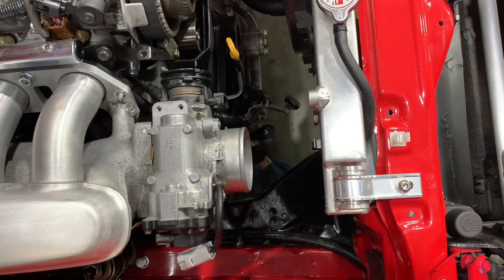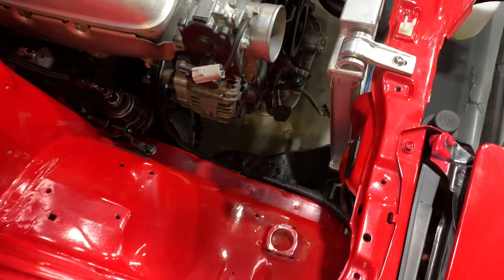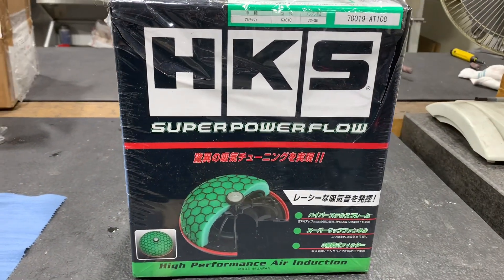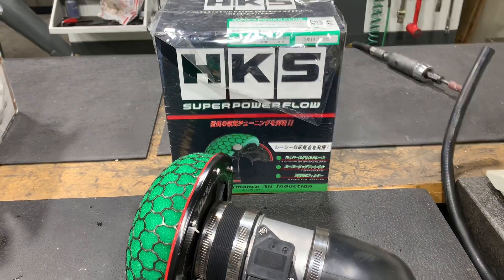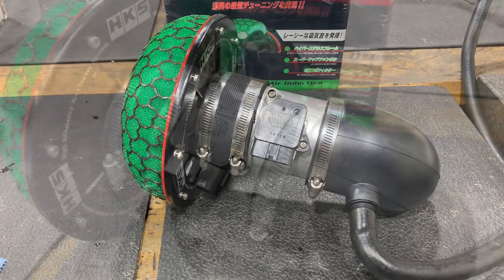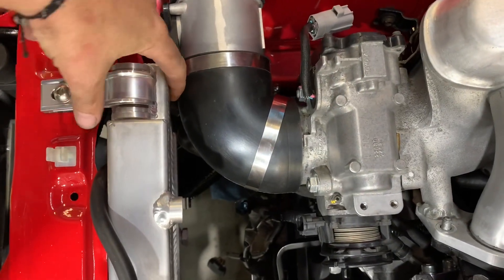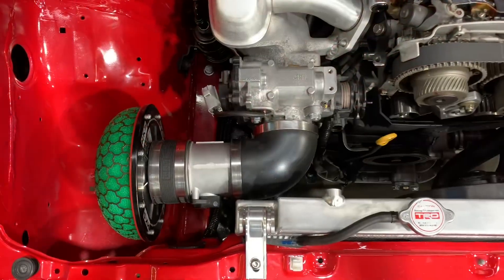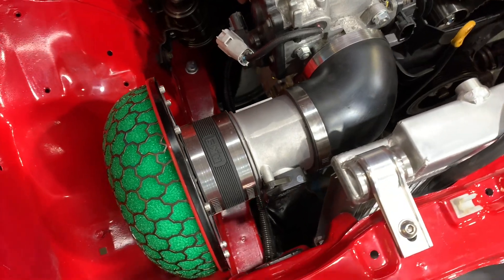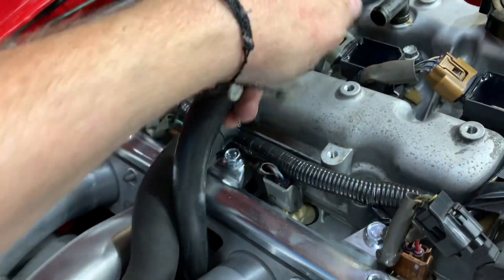The intake setup for the swap is a pretty tight fit between the throttle body and the radiator. We found that the best option was the HKS Altezza intake system, which fits into the open area pretty well. The kit comes with everything you need: the air filter, a rubber coupler, an airflow meter housing, a 90-degree coupler to the throttle body, and all hose clamps and new screws for the airflow meter. The only modification I made was cutting about half an inch off the end of the 90-degree coupler to move the intake away from the radiator. I also routed the breather on the bottom side of the intake for a cleaner look, using a half-inch rubber hose from the parts store connecting back to the valve cover.